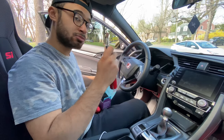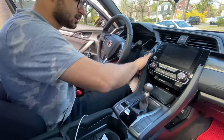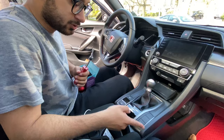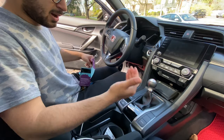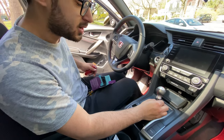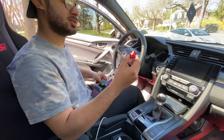So what you're actually going to have to do is have a pry tool. You're going to go ahead and take off all this trim over here, and then you're going to go up under here and there's going to be a few Phillips screws that you have to take out. You need a Phillips screwdriver and you're going to pop that open. With those zip ties, you're going to take off the old one and then put the new one on so that way you're able to apply the new shift collar.